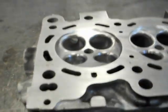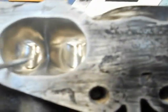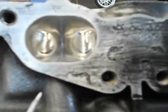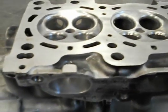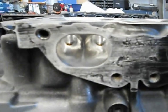Basically all I've done is gone out to around the gasket line. And then what I've done is shortened the radius — the short side radius in here in your middle separator — to give more or less of a radius, and that reduces your low pressure areas of flow.